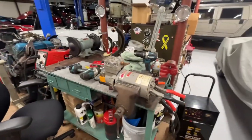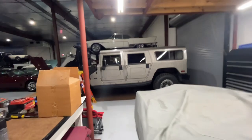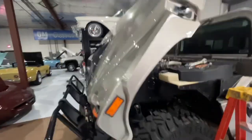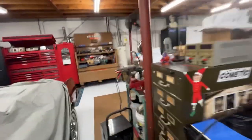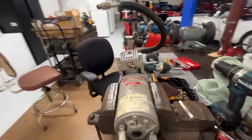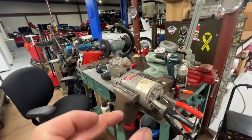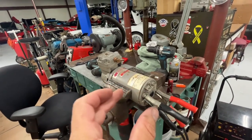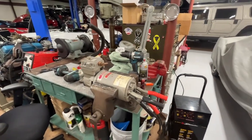Hopefully that will help somebody that's got one out and hasn't checked it yet. Most of the Alphas are kept pretty nice, and this is a real nice truck — it's got 20-something thousand miles on it. This is a very common issue where the CTIS pump fails. If this one did it, other ones are going to be doing the same thing. It's just the brush guide getting a little corrosion on it so it will not move, then the motor stops and it won't spring-load itself back into the stator. If you get that brush moving back and forth, that'll probably fix your problem. Hope that helps.